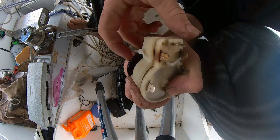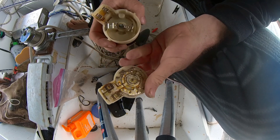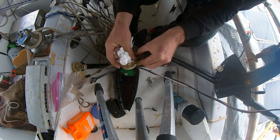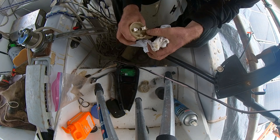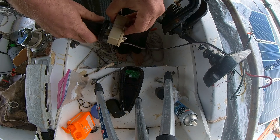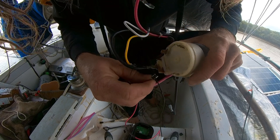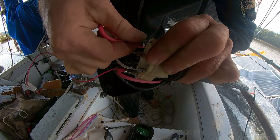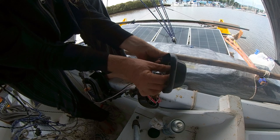This is the main component of the top end of the motor — the switch. It selects the power levels and forwards and backwards. How it works is a story for another day; I'm just going to clean it. The switch terminals are all labelled with wire colours. Fixing this type of motor is very simple — I never even had a service manual, although it would have been great if I'd known how fragile the magnets were. There are also skinny wires that plug into the top and make the indicator lights come on — they're basically just a voltmeter.